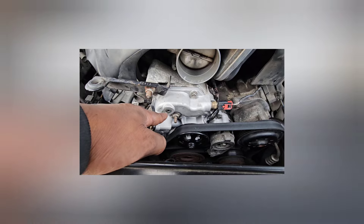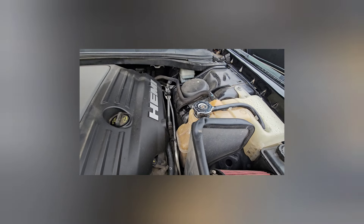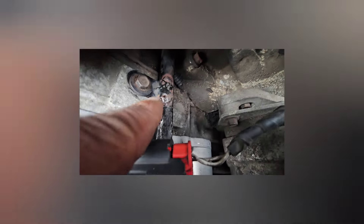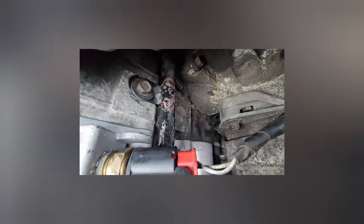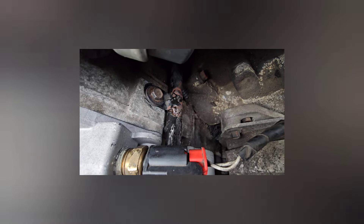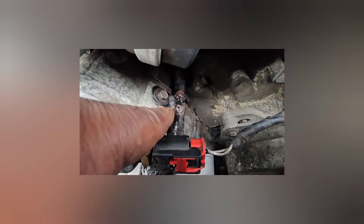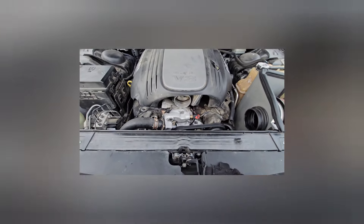You got to keep doing it while it's running. When it gets hot, it's going to sizzle and a little bit is going to fizz out of there, then you close it back up. I know I do have to get some other stuff as well — this needs to be replaced because underneath the rubber is cracked. I was hearing like a light whistling sound — could barely hear it — but once I lifted up the cap, it was cracked. And for right here, this little weld has went bad, so every once in a while a little bit trickles out. I'm going to get that welded rather than replace the whole piece. This piece is going to be welded right there on the seam where it's leaking.